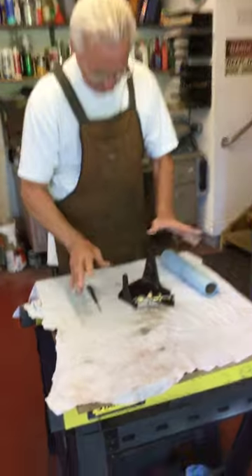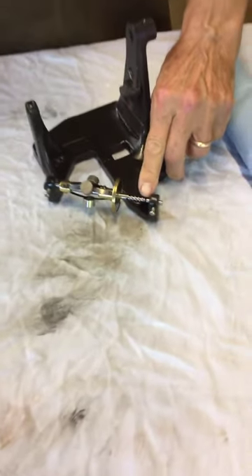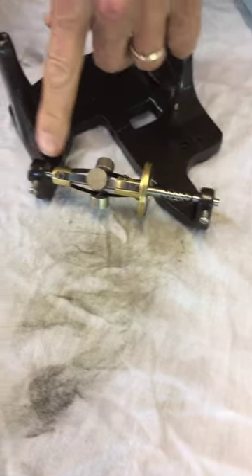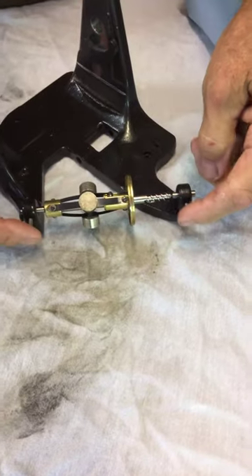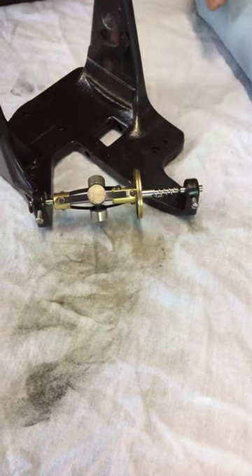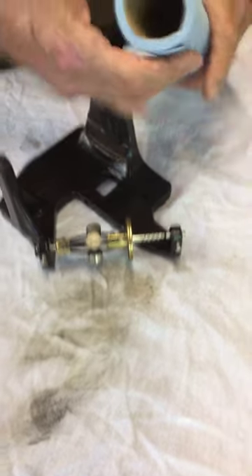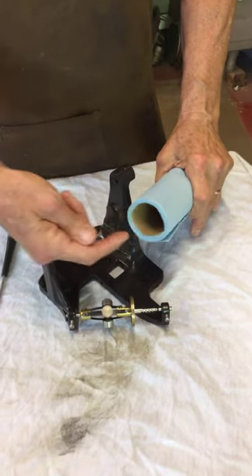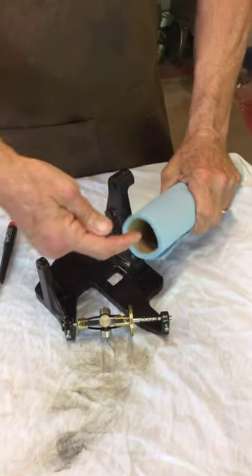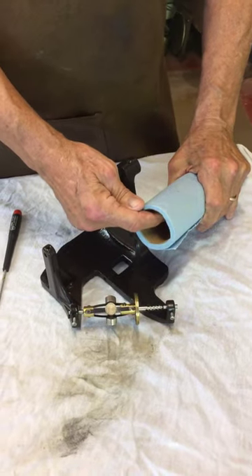I had to repaint the casting — you'll see that because it's black because I'm finding rust. You have a bearing here and a bearing here. And then you have an adjustment screw here and two lock screws. These screws are for demonstration purposes only. The inside of the governor, right here, there's a hole where the pin of the bearing goes in. There's a little ball bearing in there, and you want to make sure that little ball bearing is in there.